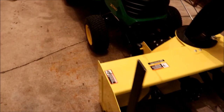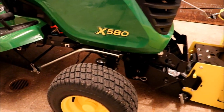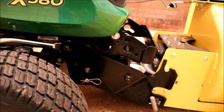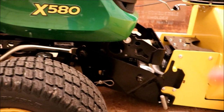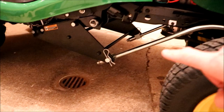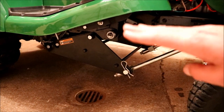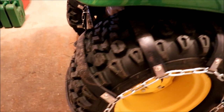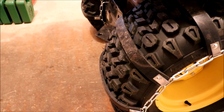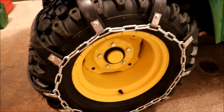We'll show you the snowblower: it's a 47-inch two-stage, belt-driven. The X580 has the power lift — there's a plate that gets pinned through on the front of the frame, standard John Deere hookups in the front, and these arms go over the top of the axle and come down. You put a triangular piece on the lift arms of the mower deck area and that will actually lift and lower the snowblower. We also got rubber straps instead of chains so it shouldn't mark up the driveway. Maybe we'll get some video of us blowing snow later. That'll be it for now.